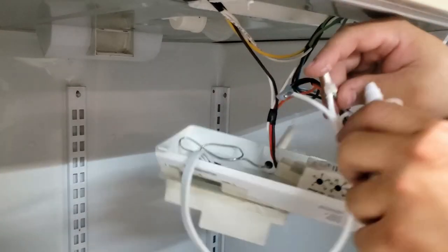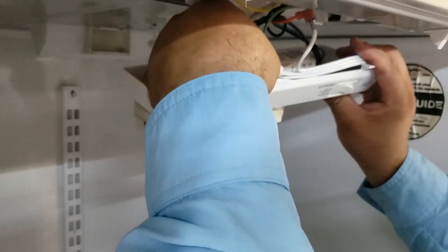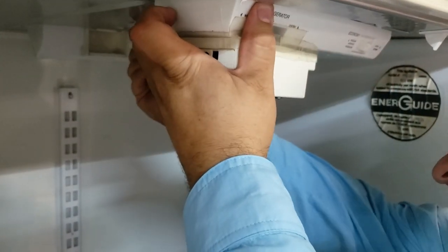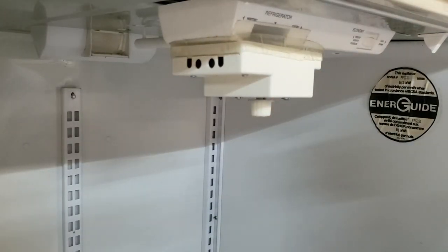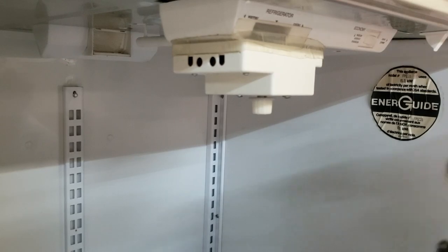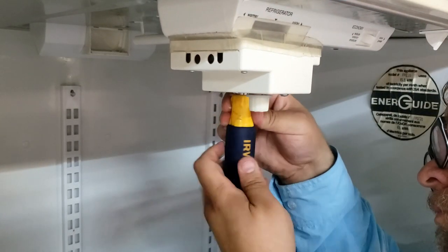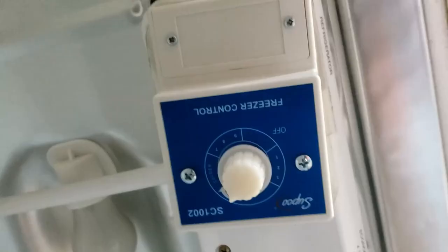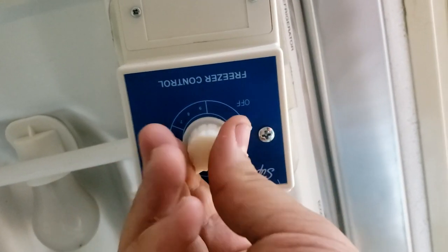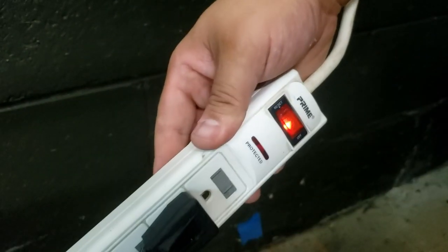With all wires installed and mapped correctly — making sure ground matches to ground — putting the modified wire pack back into the housing is somewhat of a challenge. I've added three large new wires to the housing while keeping the same size configuration. This unit uses two plastic retention pieces in the front and a single rear screw, so it's time-consuming to make sure the wire pack is properly seated. The Supco cold control has a very variable adjustment knob with a range of roughly negative 5 degrees up to about 25 degrees, so it needs to be kept on one of the much colder settings.